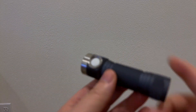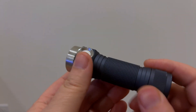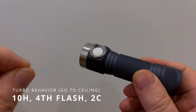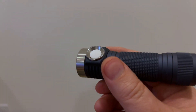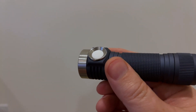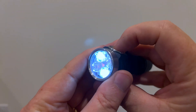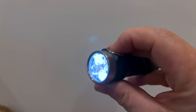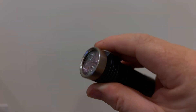Now we also have to set up the ceiling and the turbo modes. Let's do turbo modes first. While it's on, do a 10-click hold until four flashes, and then give it an input of two. The 10H is an advanced menu with a bunch of different selections. So go 10-click hold until you see four separate flashes, release on the fourth flash, wait for the buzz, and give it an input of two — one, two. Now you're in the old-style turbo.